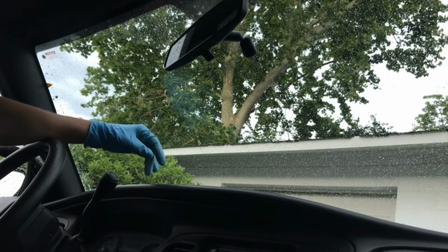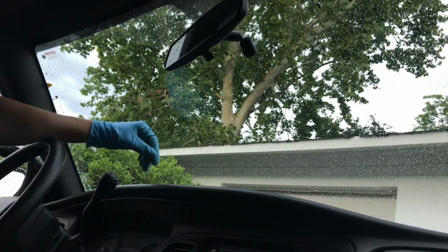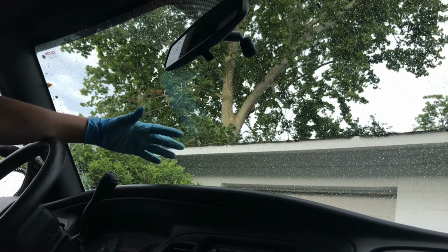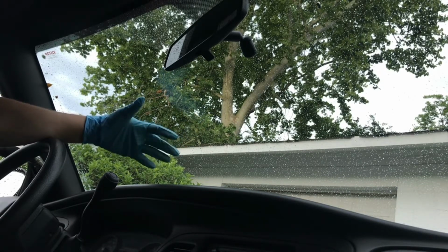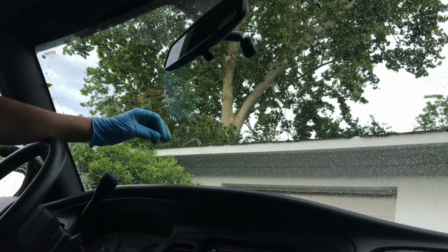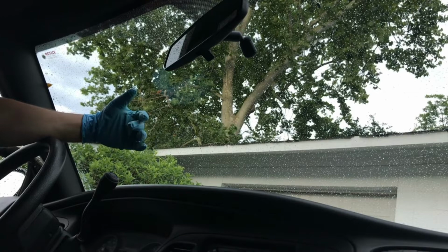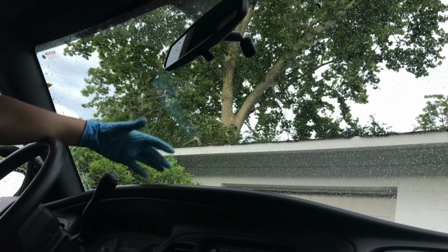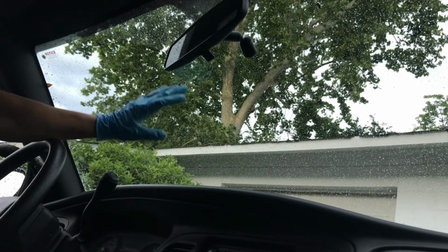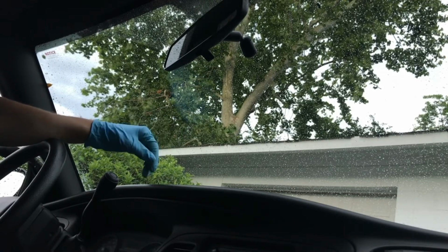The third thing that everybody has to deal with, I actually didn't know anything about until a few years ago when I was educated on it, is called off-gassing. Your interior has a lot of plastics. Those plastics over time heat up, expand, contract, all those types of things. They're being heated up a lot by the sun, and when that happens, they release gases. Everything inside your car is releasing some form of something that attaches to your windshield. And that film is, I think, one of the more difficult ones to actually remove besides smoking.